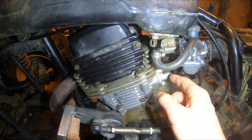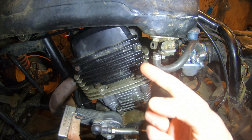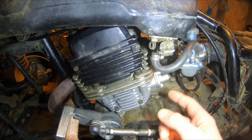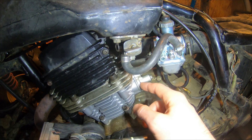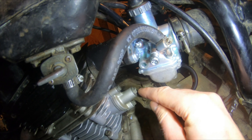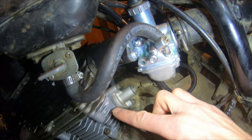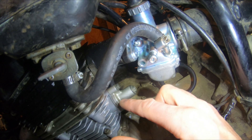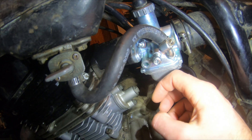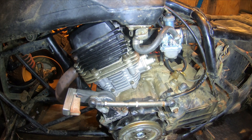I had this out the other evening — I'm just re-inspecting my work because everything was tighter than I thought it should be. I thought I needed to oil the rings, which I've done, but when the tensioner was out the motor was spinning freely; when it's in, not so much. I'm going to take this out, and what I expect to find is under this 10-millimeter bolt a very small flathead screw — I'm expecting to turn that clockwise to release the spring and recoil it back in so I can put it in. All the way clockwise should lock it open, then maybe a quarter turn back to unlock it — it pops in, goes to where it should be, and the motor should spin freely.